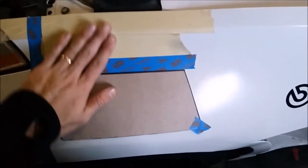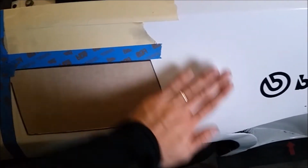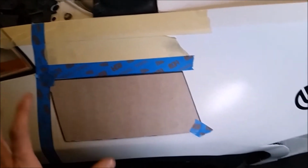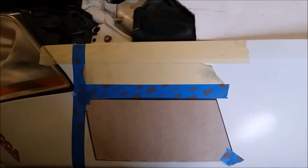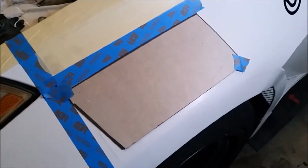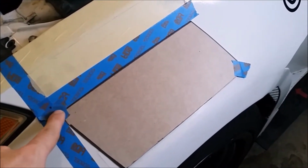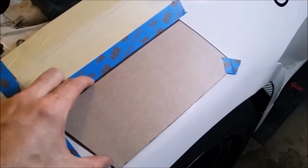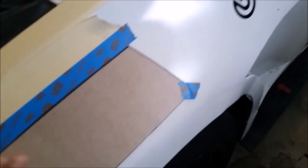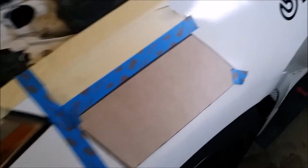and because this is such a complex angle, this is arching over here, this is flowing out and down. It's a really weird shape, and that's a flat panel, but luckily the louvers make it easy for it to change shape a little bit. But I'll start with riveting the top one up here and then work my way down and around until we get to the bottom corner here, to gently form the panel to the fender.